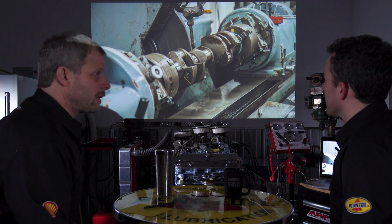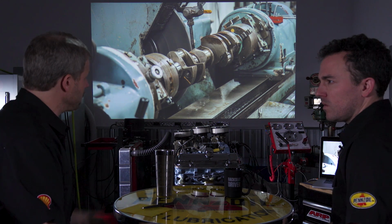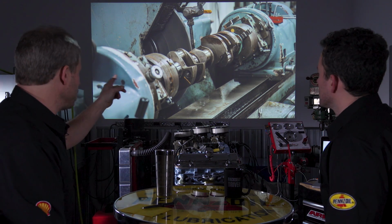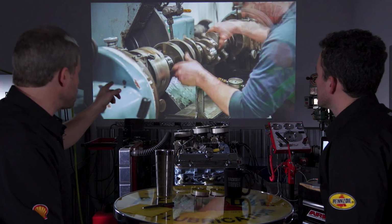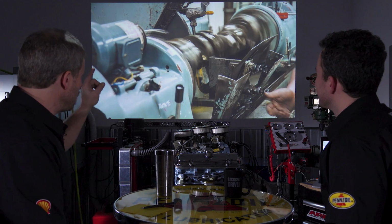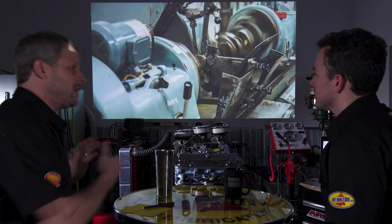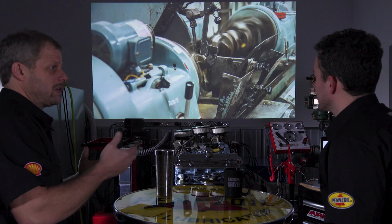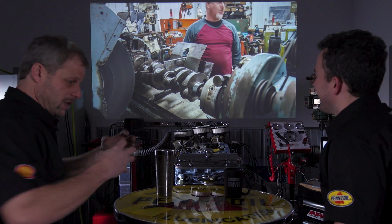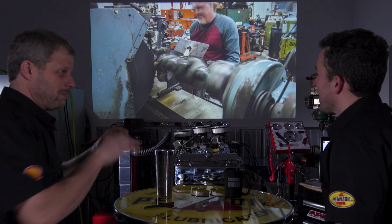So that was pretty in depth, but we cut this to 40. This crankshaft was 30. One was 30 and one was 40. Okay. I believe this one is the 30. So what is interesting though is the crankshaft turns, that stone does not rotate, it spins, but it does not move in and out. So when you have the crankshaft spinning, the mains are relative to the ends, right, centered, but the throws are not, or the rod bearing size.